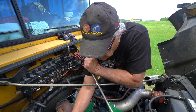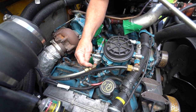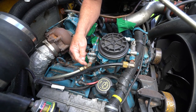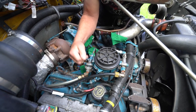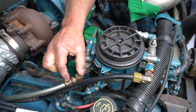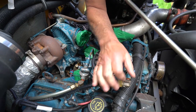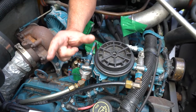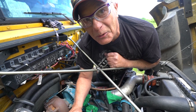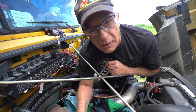We're going to come in here — I'm explaining this so it sinks in. We're going to put a VO electric valve here which switches between diesel and waste veggie oil. And then up here, we're going to do the same thing. This one here we're going to run on default — what I mean by default is with no power: you turn the key on and start it, it'll run on veggie, not diesel. Everybody's saying 'what is he doing?' — but he's going to run this mostly on veggie oil, so instead of burning out the solenoid, we default on veggie and use electric to switch to diesel.